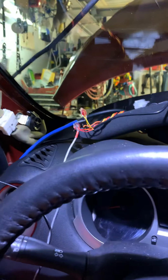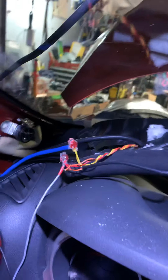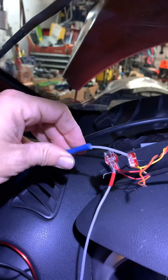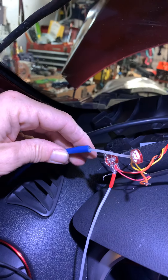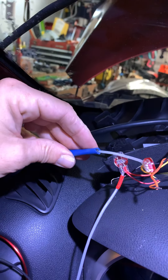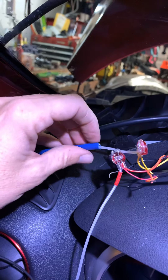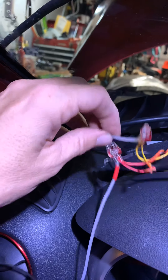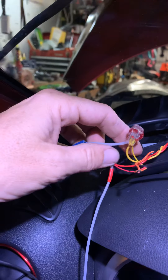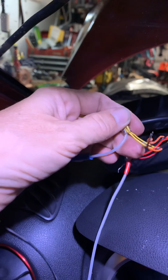Just want to get you caught up before I get going too far. I'm using a Belden cable — it's a shielded cable used for running sensors through buildings, refrigeration temperature sensors, things like that. There are two conductors in here but I'm only using one. Yellow is always hot if you remember from the previous videos, so that needs to go.